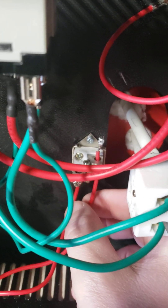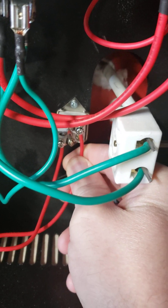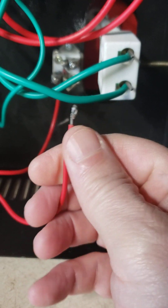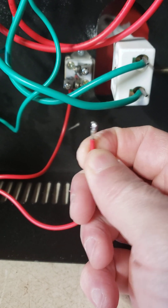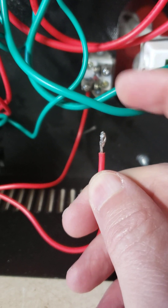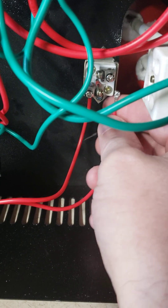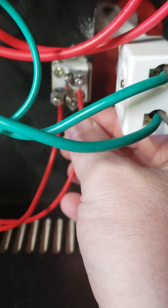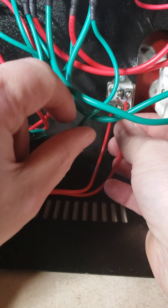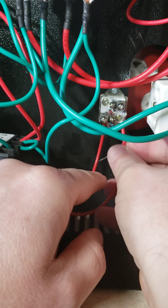I over-exaggerated this just so I could get the 4H code again, but with this unit when I received it, it was down in there — it looked like it was okay. I believe it was probably okay coming from the factory. You'll see how the ends of this have a kind of a ball of solder. I think what's happening is when they screw the screw on there, it's hitting this ball, and through shipment it actually ends up sliding down. So you want to check both of these screws back here if you're getting that code, to make sure that they're tight and the wire should not move at all.